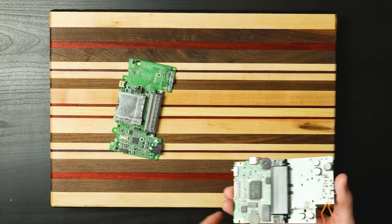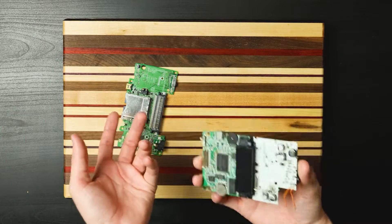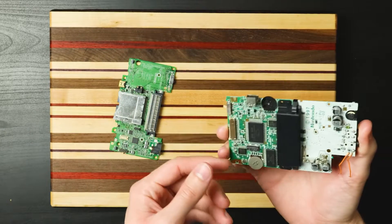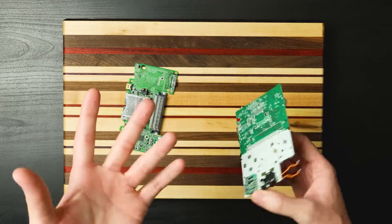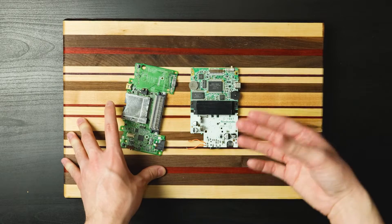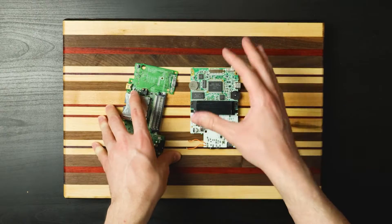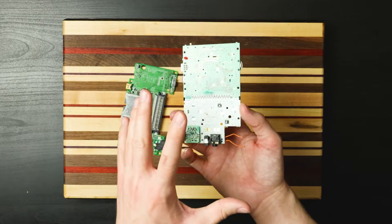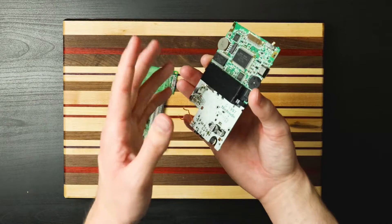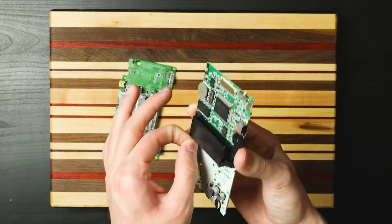Isopropyl alcohol will probably do the trick for most people, but I've fixed hundreds of Game Boys across all models and the ultrasonic cleaner definitely helps. I'm still not testing boards when I get them in. When I got these pockets in, I tore them down and immediately started reflowing all the solder. If there was obvious corrosion somewhere, I took care of it by removing the corroded part — usually it's the battery terminals.